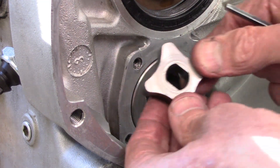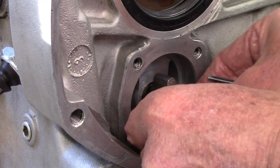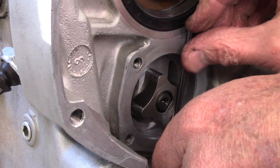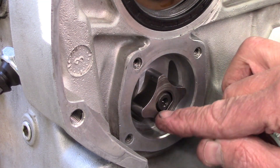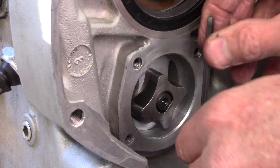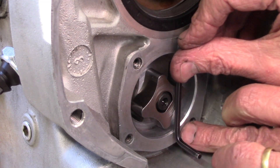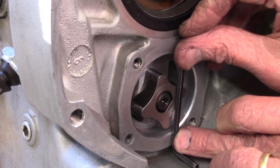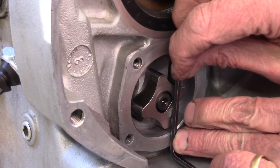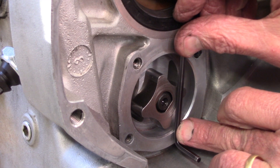I also need to do that on the inner rotor. I pull the outer one away and put the inner one in. When you put the wrench across the inner rotor, don't get it across the end of the camshaft — that's proud of the face of the rotor. You want to get it off one of the lobes, and then slide your feeler gauge in — probably from this edge is the easier way — and you can get a good measurement on the end play of the inner rotor.